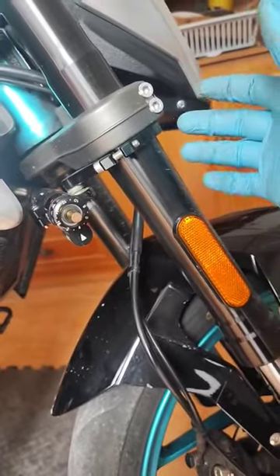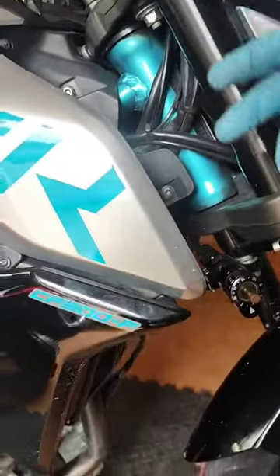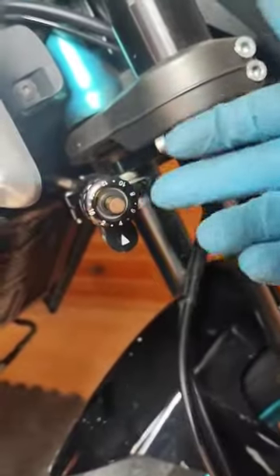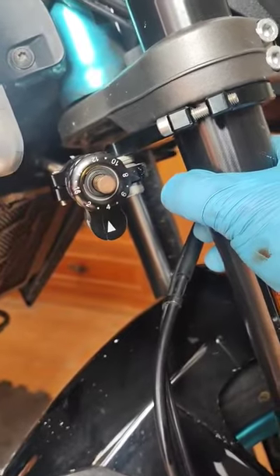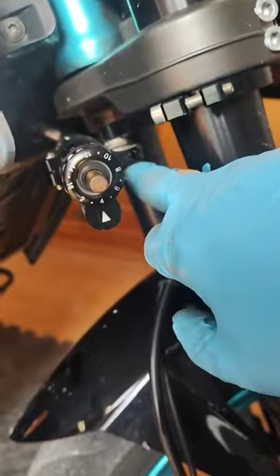With my mechanic we just installed it on the opposite way because I wanted to put it on the top, but unfortunately that was not feasible, so we installed it on the bottom. The ring here is keeping the stabilizer steady, and the only thing we did was create a spacer, as you can see clearly in the video, and we tied it to the radiator screw.